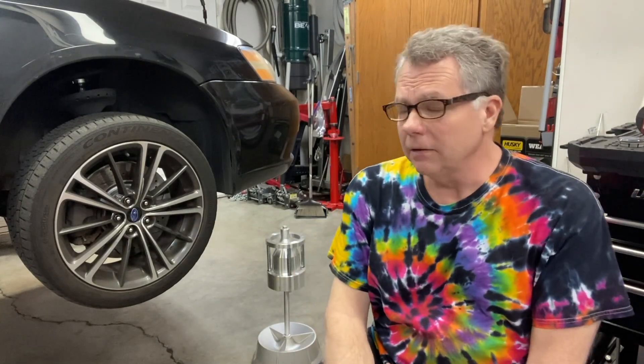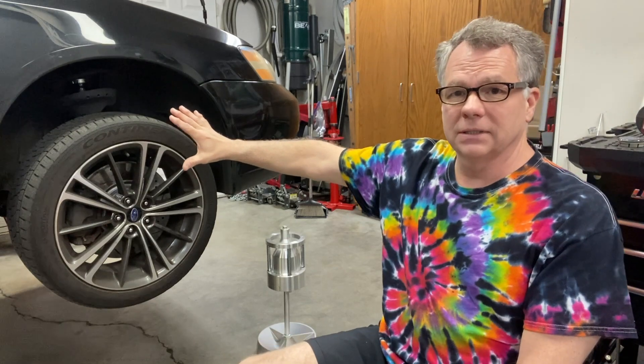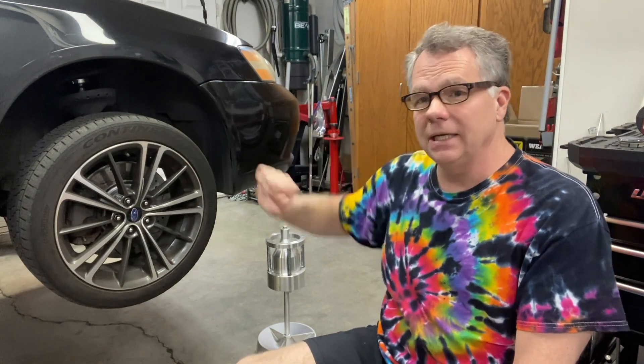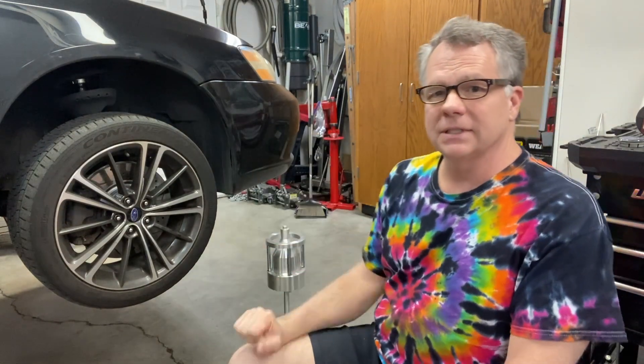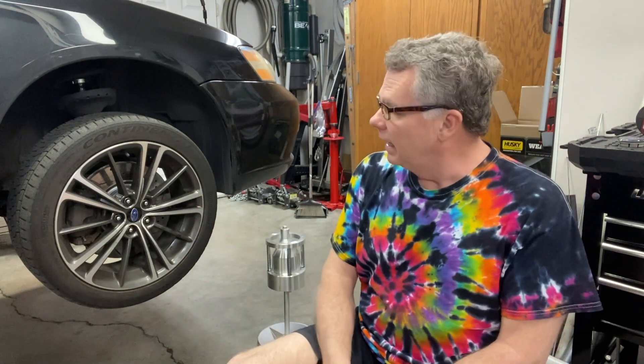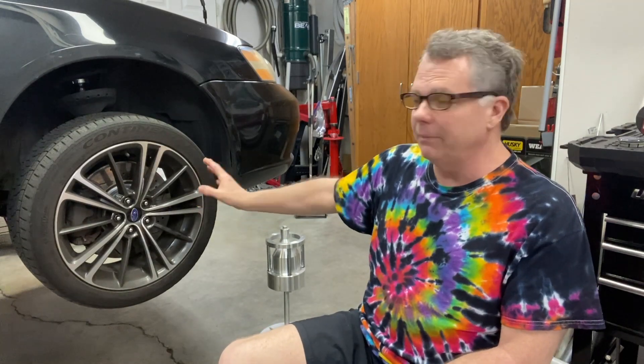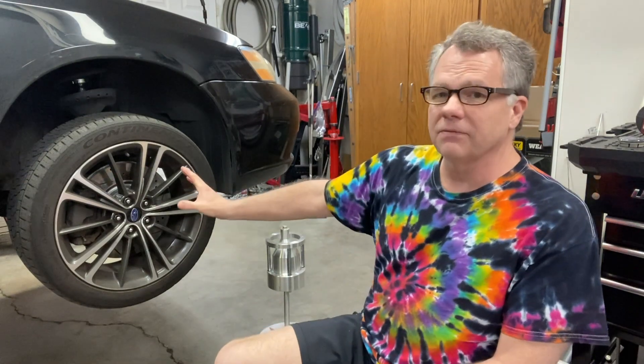Hello and welcome back to Matt's Automotive channel. About 2,500 miles ago we put on a new tire and wheel combo on this Subaru Legacy GT, and it had been great ever since until now when we recently detected a vibration at freeway speeds. Definitely through the front wheel — you let go of the wheel and you can kind of see it shake back and forth. My hunch is that since these wheels were perfectly balanced when we put them on, a weight has likely fallen off and caused some imbalance.